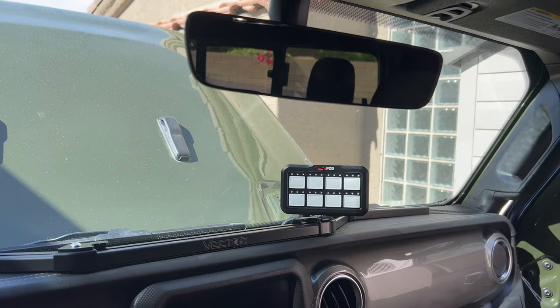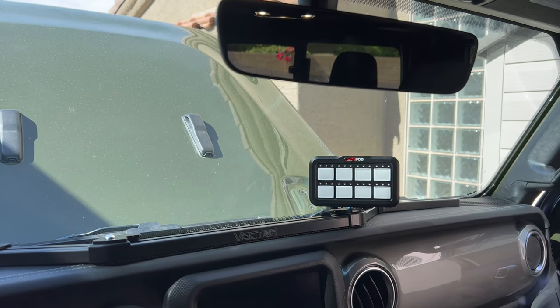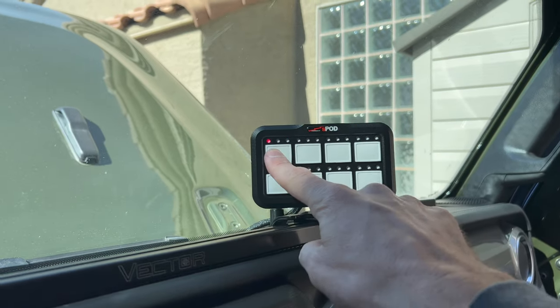Some of you may wonder why I chose the button version of the S-Pod controller versus a touch screen, which is pretty popular now. I read that the touch screen is pressure sensitive — not heat sensitive — so you do have to give it a good push. With the hot temperatures here in Arizona, I didn't want any issues with the screen sitting up there in the sun. I also prefer the tactile feel of buttons for something like this, especially since it'll be controlling the E-lockers for the front and rear UD60s on the Gladiator. I like being able to push the button, see it light up, and know that it's engaged or disengaged. The touch screen is a great option for some people, but for me I prefer the silicone button.